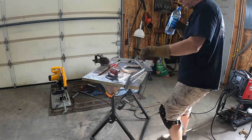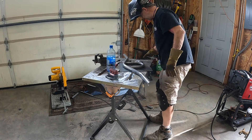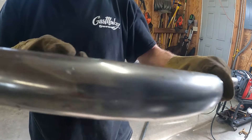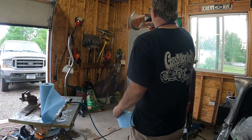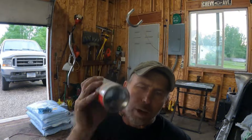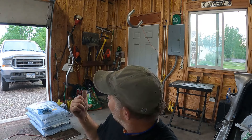Doing a little welding on the inserts with a bad light situation and an unprotected finger. There's one spot I missed - there's a little ugly weld on one side where my tip got caught in the groove, but it still fits on there and that's all that really matters. We got it all welded up. Now it's time to drill some holes, bolt everything together, sand it with some 220, and paint it black. We'll do one or two coats of etch primer and then chassis black. I'll probably let it dry for a few hours and work on installing gauges or something while it dries, then put this thing in the car in the morning.